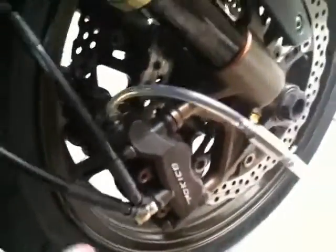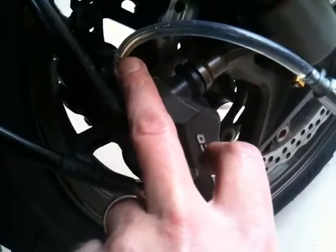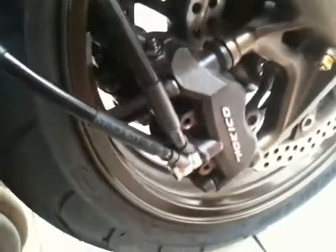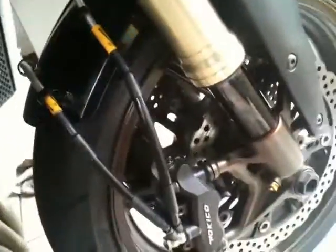So what I maybe haven't mentioned is, when you've done a bit on each side, with this tube still connected, tighten this up first. So that's tight now. I'll just cinch that up a bit. Now, take this off. And all the while, make sure you're careful with this brake fluid stuff, because it's blooming horrible and it will knack your paintwork and other things.